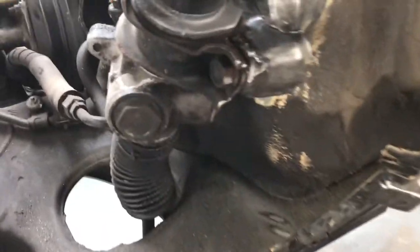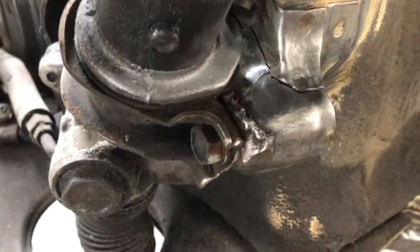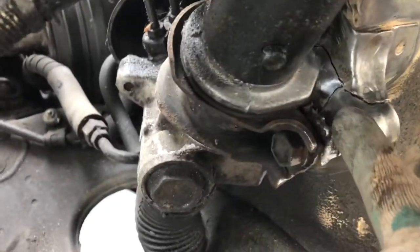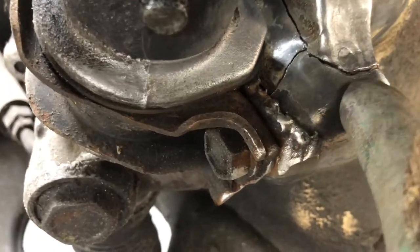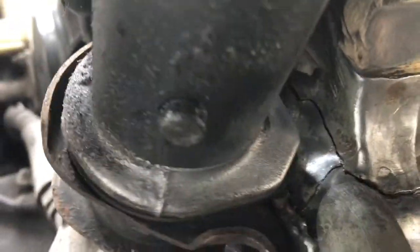This is exactly why we do this. Check that out — that is the steering rack mount, the main rack mount. Look at that. Someone's had to go welding it before. Cracked, cracked, and cracked all the way on the back. So now the steering rack has to come out. It's fighting me, this car, all the way. But on a positive, this is why you do this — so you can find any inherent problems and get it sorted out.